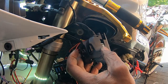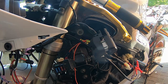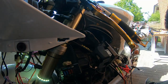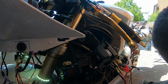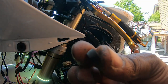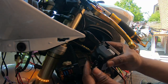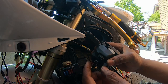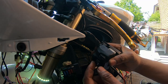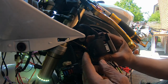Because the indicator is not working. I think the hardest part of installing this is cutting these rubbers so they fit perfectly. You don't want to be pushing the indicator too hard to turn it on — one tap and it should come on, press it the same direction and it should turn off. You just want to cut them enough so they don't lock.